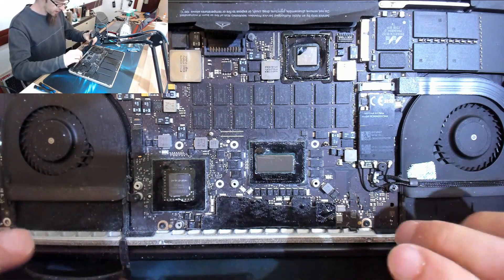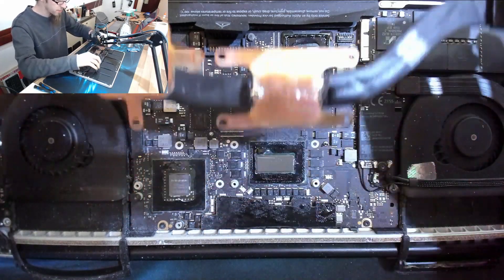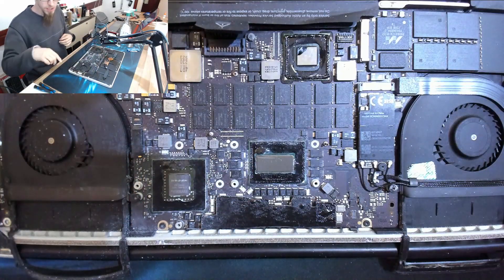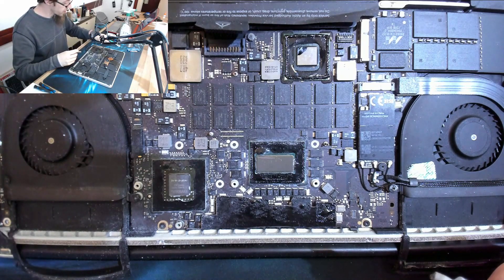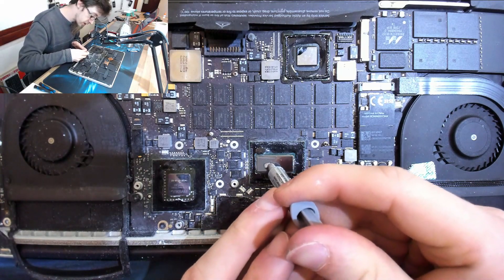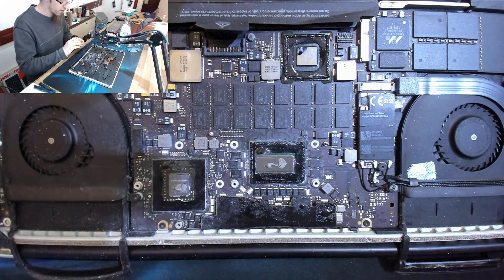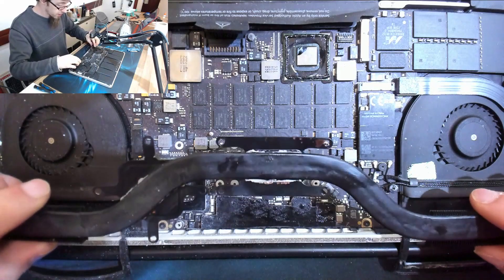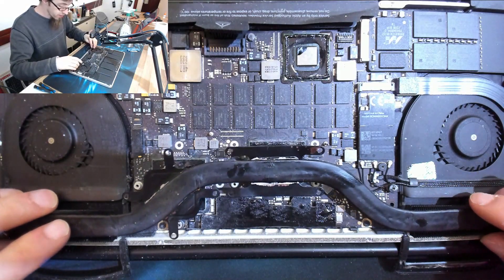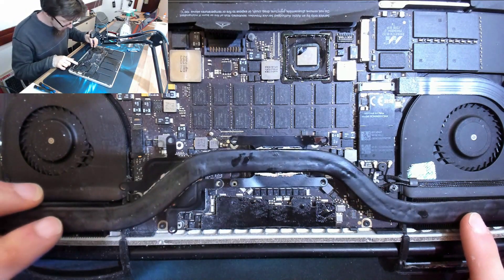I've cleaned up the heat sink. I tried to solder the plate back onto the heat pipe, but that heat pipe just heat-soaks away anything I put on it. Even with my soldering iron turned up to an obnoxious level, I can't get enough heat into it to make good contact. So I'm just going to put this in place, get in as many screws as I can, and just hope that holds it well enough for me to test the laptop.